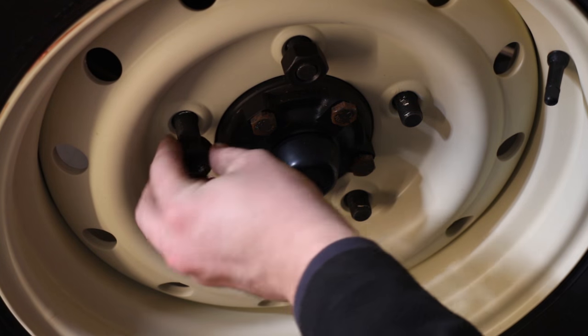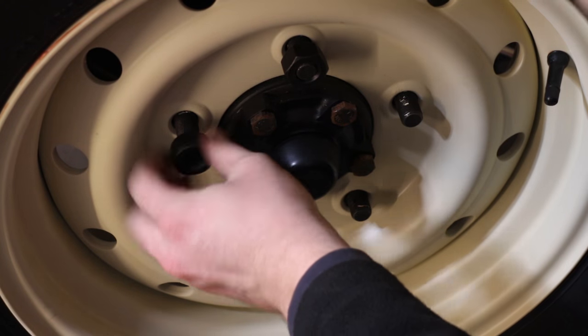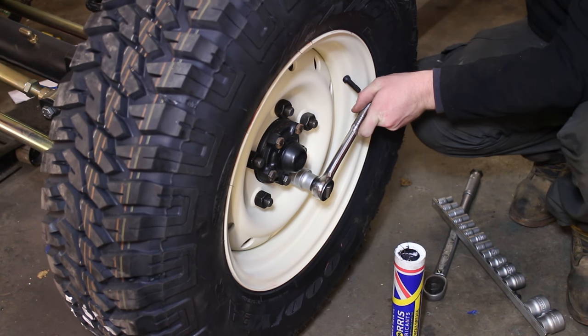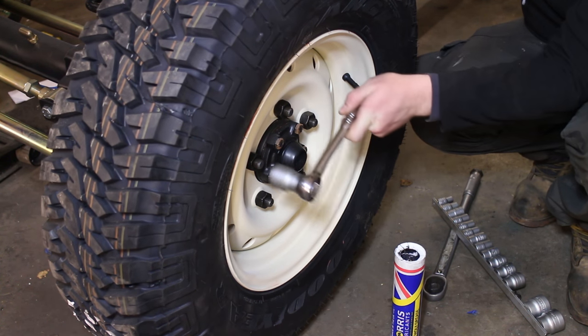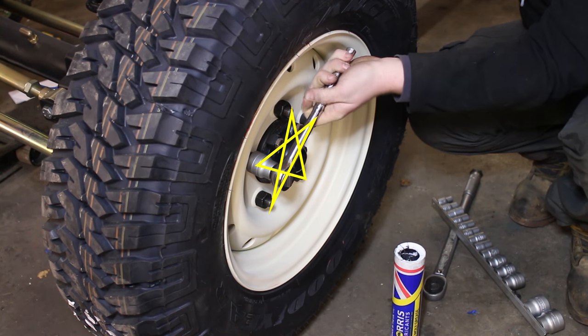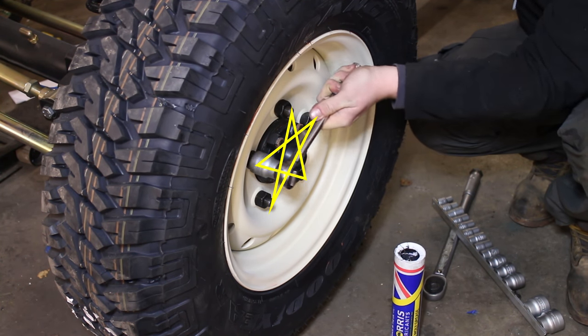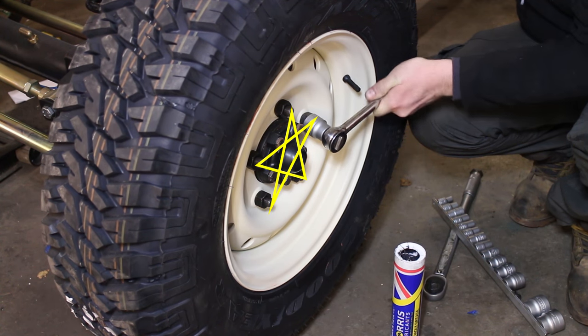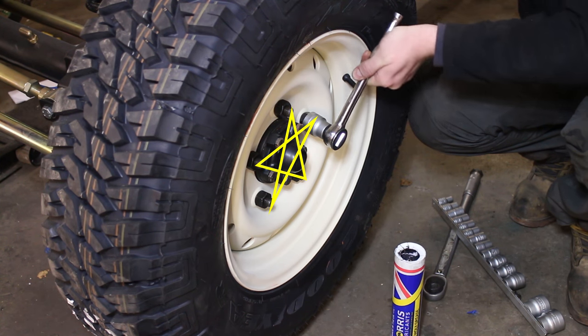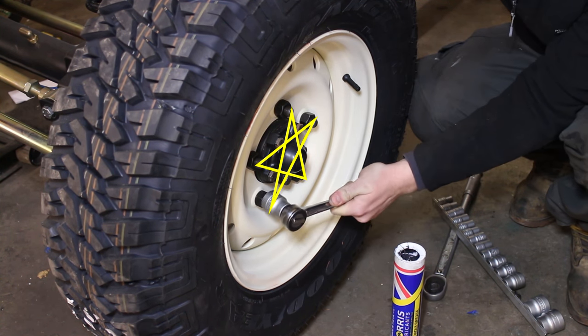I've got 20 brand new wheel nuts here so we can put these on now. First tighten them lightly, which stops our wheels from falling off, then we can tighten those up with a socket. Don't ever tighten your wheels fully in the air — it could rock the vehicle off its jacks or damage the drivetrain. Always tighten them incrementally in a star pattern going to the opposite nut, which torques them down evenly and makes sure that they're seated correctly.